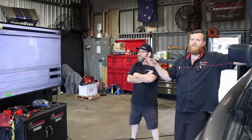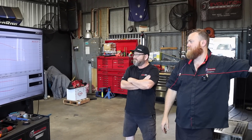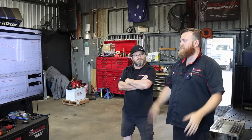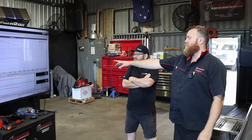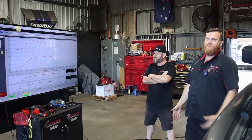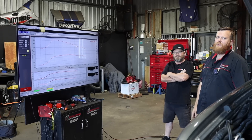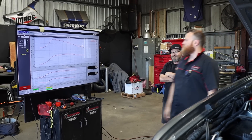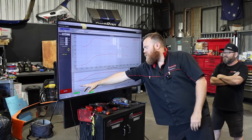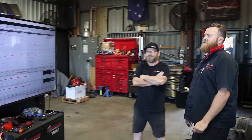We've just done a first run on the thing to get a ballpark idea of where the car's at and how it's performing. Honestly, considering there's no wastegate and we're basically just free-boosting this thing, it's pretty good. It hit about 26 pounds at peak boost, and it's like 26:1 AFRs when it's on boost, which is super lean — that's why Guzzy's not seeing higher EGTs or anything wild out of this thing. Peak torque rolls on nice and early at two grand, and it's at 20:1 AFRs out of the hole, so it's not overly fuelly — it's really nice pump control.